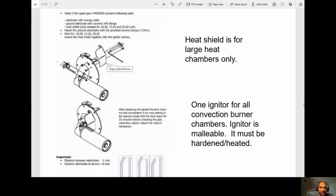So what they want done is after replacing the igniter, the tech must run the Convotherm on max setting in the service mode with the door open for 25 minutes before checking the gas valve flue values. Adjust the valve if necessary. Okay,